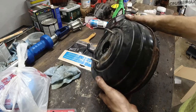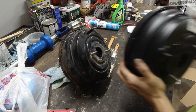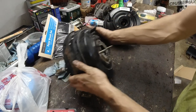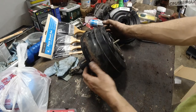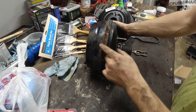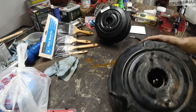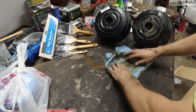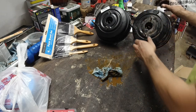There's actually fluid inside. No fluid — oh, I guess we just need to replace the brake fluid on the inside of the booster and put it right back in. No need for the new one. Actually wait — it's water. Look at this, it's not brake fluid, it's water. We've got a booster full of water. That's a mess.